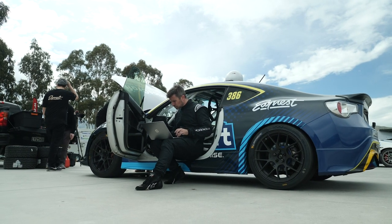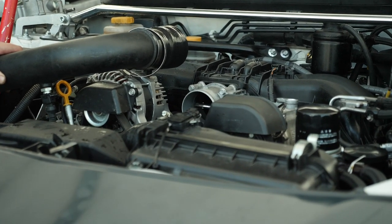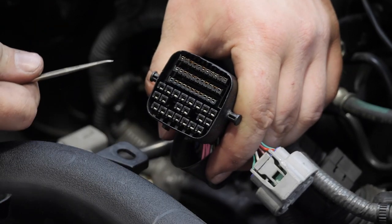By digging a little bit deeper into the data, at the same point where the throttle was playing up and we're seeing that erratic signal, we're also seeing erratic signals from a few of the other sensors — sometimes the manifold pressure sensor, also the oil temperature sensor. This really suggests it's possibly either the 5-volt regulated feed to these sensors or alternatively the sensor 0-volt reference. Digging further, the root cause of the problem was the factory bulkhead connector that goes between the engine harness and the chassis harness near the firewall — the disconnect between those two pieces of harness if you need to take the engine out. Importantly, this is 100% stock standard factory connector; all of that wiring has not been touched and has been in the car basically since we've owned it.